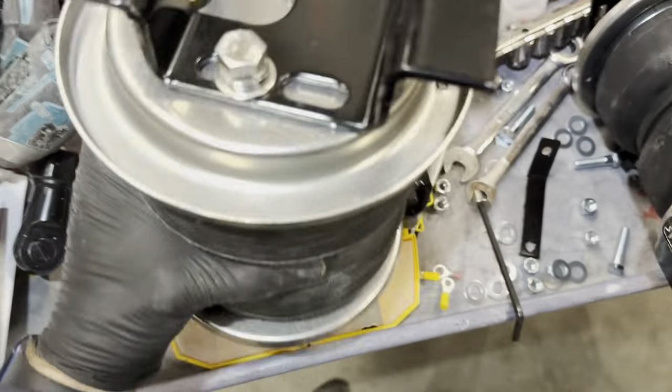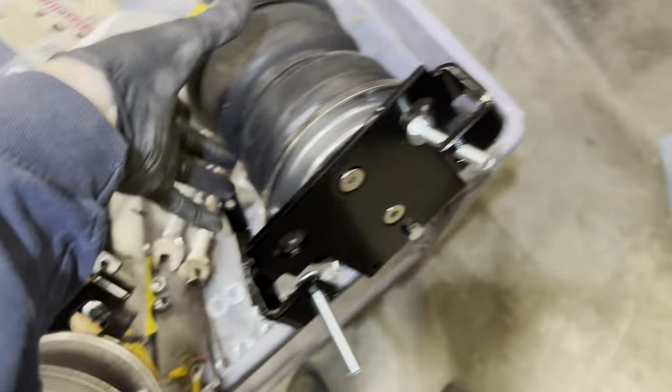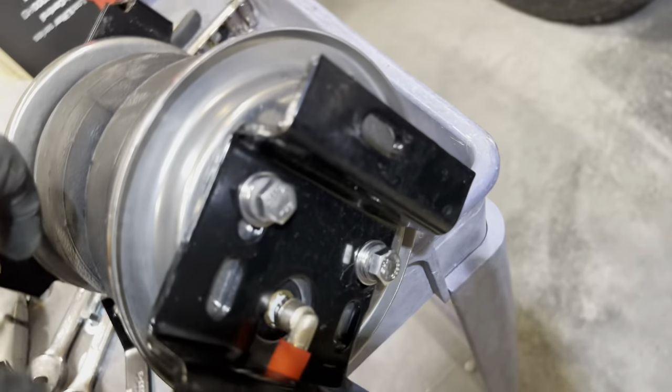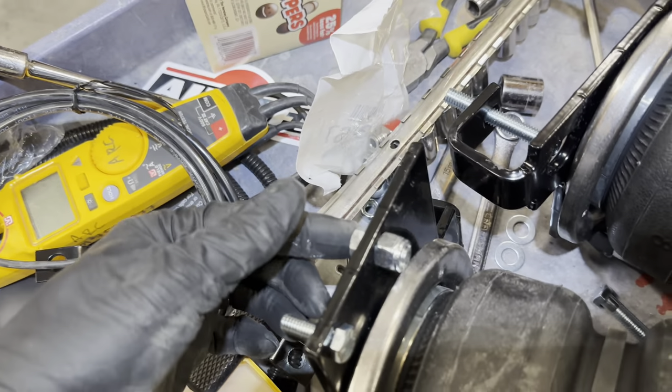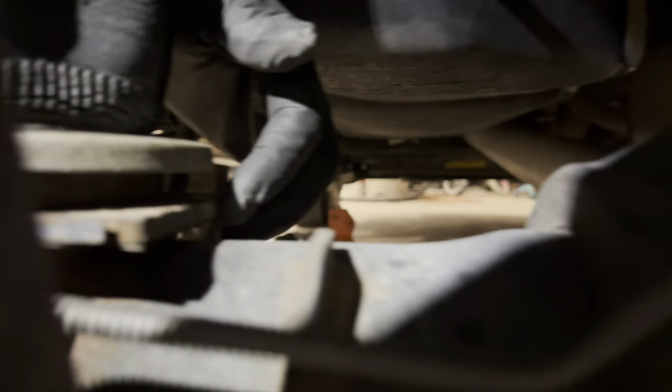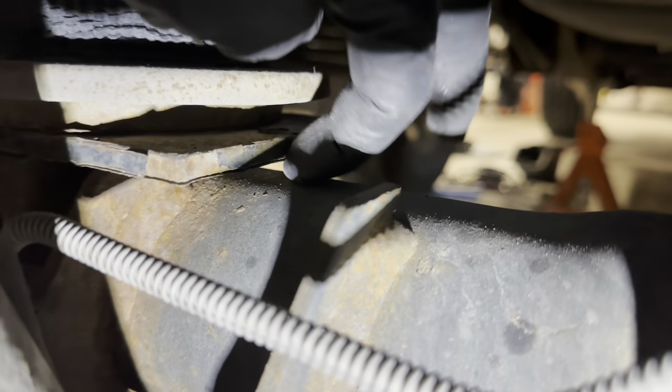Also, there's a left and a right side. You'll see that in the instructions — driver's side mounts are A, these are B. So on the passenger side, you can see I've got those mounted on the B part. That little bolt is only for the 2500 models, which is that one there. If you look on the other one, I don't think they have it on there, which is right here. It looks like this one doesn't have it — it should have gone right there. I wonder if it just bounced, just to put something right there to prevent bending.